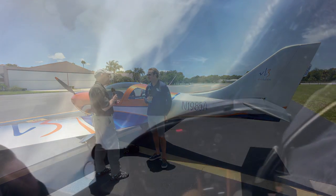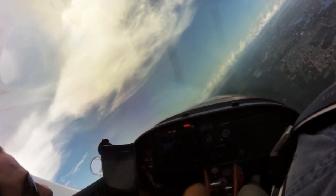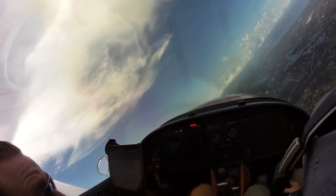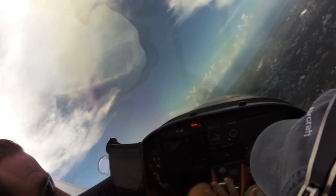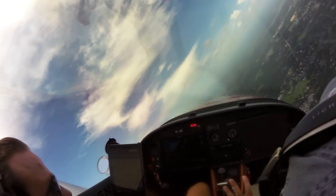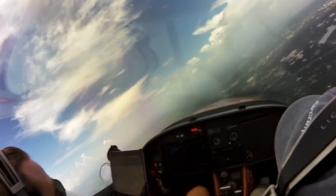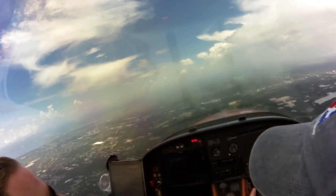This one's no slouch either. Kyle and I went up and flew — we took off at 5,500 RPM, 35 inches, and were seeing a climb rate of about 1,400 to 1,800 feet per minute. This model has an electronic constant speed propeller that you can adjust for proper RPM, with both an automatic and a manual mode.